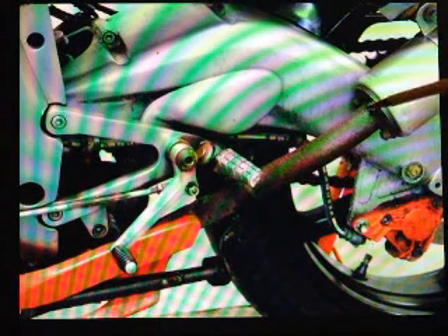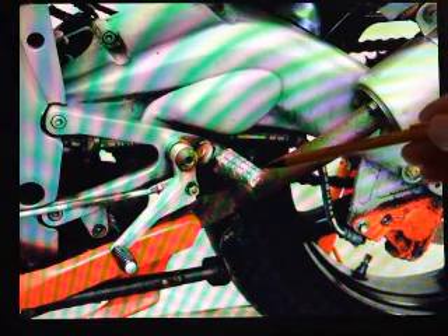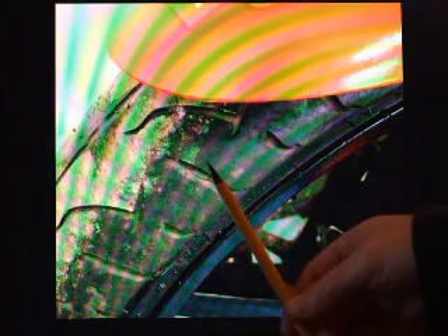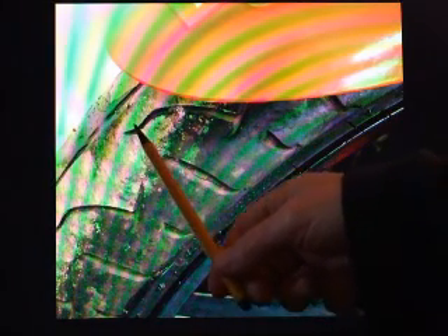This picture is just showing the state of the exhaust — it looks rusty. Obviously the bike has been sitting around for quite a while, but there's that to consider. I also notice the end of this footpeg here is broken off, though it's still usable. The front tyre is getting quite worn — you're going to need to replace it at some point. There is some perishing there, but that's not too severe to foul the MOT; however, the depth of tread probably could be, so you're likely going to have to change the tyre before long. The rear tyre is pretty much like new. The rear shock absorber feels weak to me — I know they often feel like that on these bikes, but that one also feels soft. Whether you need to adjust it up or replace it, I don't know, so that may need some attention.